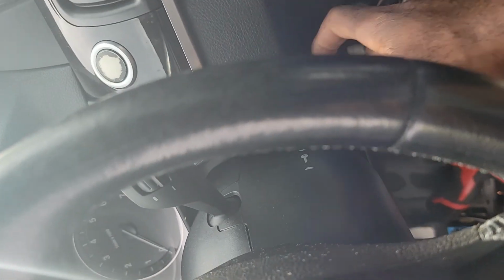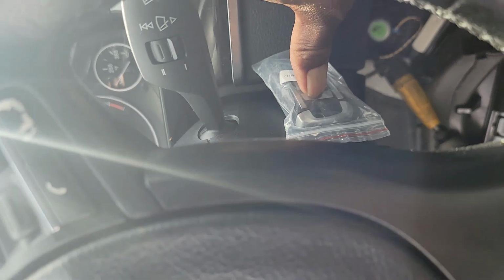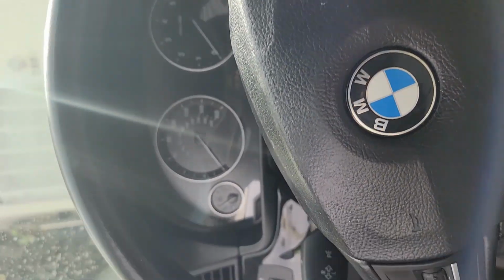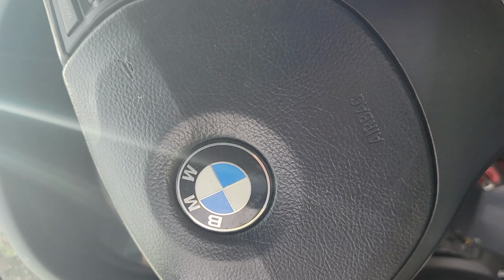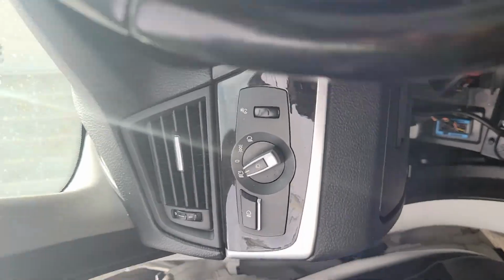We've plugged in the Cas4 module. That's the key. You hold it up to the side of the steering column where the picture of the key is, like that, and then you press the start button and it lights up the dash. It reads the key rather. Turn it off, make sure your power locks work. That's the only thing. See, if you don't use the correct frequency, it'll light up the dash and start the car, but your remote functions won't work.